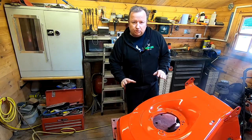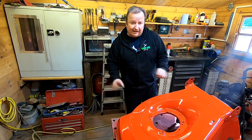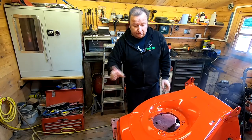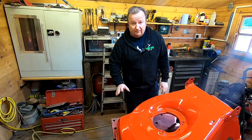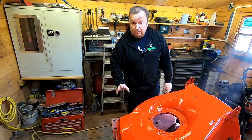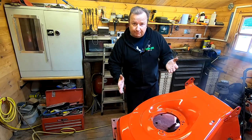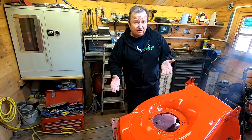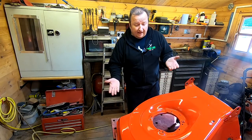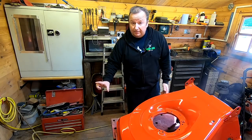The lacquer we're going to put on top of it is going to be impervious to petrol, so you don't want to just go over this with a normal rattle can lacquer, because you'll find that as soon as someone spills any petrol on it or something, it'll all start to bubble up. So you've got to protect it. We're going to do it with a 2K car lacquer, as we normally do, and that will seal all this paint in. So it doesn't really matter what grade of paint you use for the base coat. As I said, this is just normal £1.50 cans we got from a car boot sale, and it's just providing the colour. The protection comes with the lacquer, and it's a good quality lacquer we use as well.